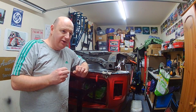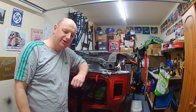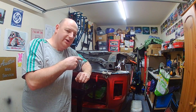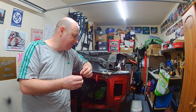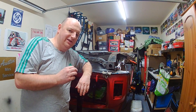I lined it all up and I thought it was lined up quite good with all the arches, the rear panel, the floor, the rear seat panel. My plan was to get this subframe — which is what I picked up with the 1979 Clubman — and use that as a jig. It took a few hours to get it exactly how I want it, manoeuvred into place. You move one bit, it moves another bit, and it just takes time. If you rush it, you're going to get problems down the line — the panels will not line up, the car will grab, the subframe will not line up. You just need to make sure you take your time.